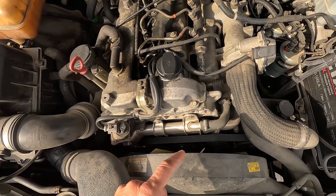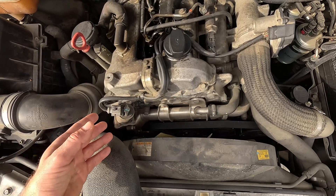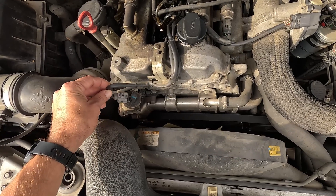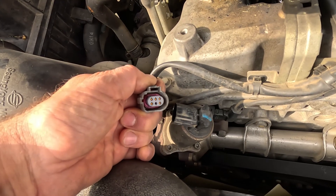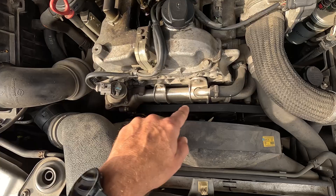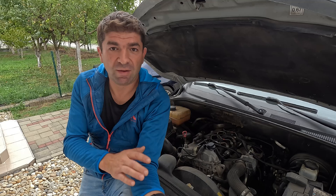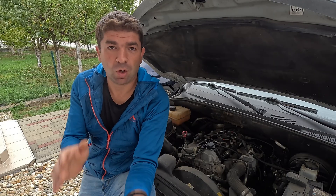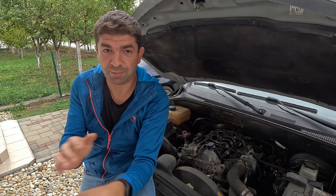Find the valve — it's usually mounted on or near the intake manifold — and take a good look at it. Are the hoses attached to it cracked or disconnected? Does the wire connector seem loose, or can you see traces of corrosion on it after unplugging it? Do you see any carbon buildup on it or its ports? If you see any of this, it's quite likely the valve isn't working as it should, and you need to replace the broken hoses, take care of the corroded connectors, or clean out any carbon buildup within the valve using carb cleaner.